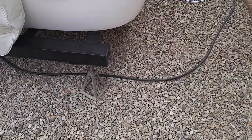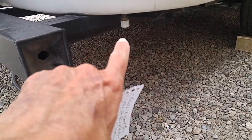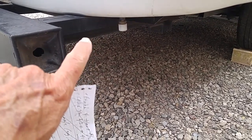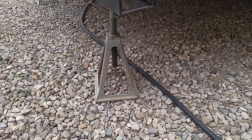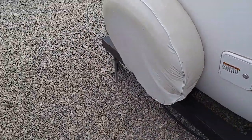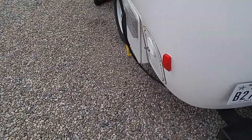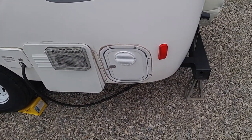Number one, outside. This travel trailer came with screw-down jacks mounted right up under here, but they're not there anymore — I took them off. Why? Because this unit does not have the high-lift package. You can get the high-lift package, which raises it about four inches, giving those jacks plenty of clearance. If your trailer has screw-down jacks without much ground clearance, you've bought a problem — going in and out of gas stations you'll probably drag them off. And if you go boondocking or dispersed camping down a rutted road, goodbye screw-down jacks.